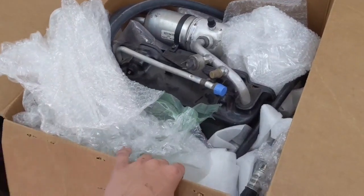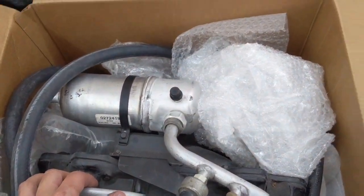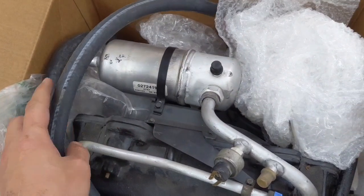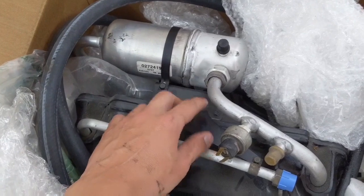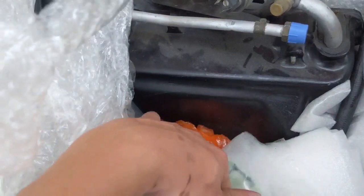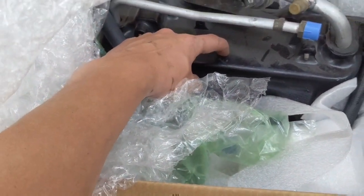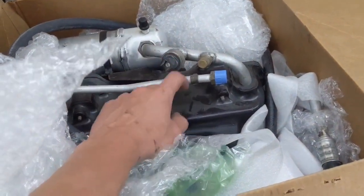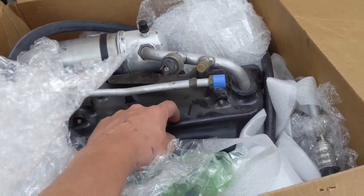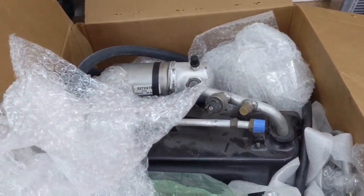Option three is a custom heater box done by Custom Image Corvettes. This is for guys who didn't want to use the vintage air system but still wanted to retain what they have. It goes in place of your original heater box. Now you're going to look at this and think it's the same box, but there is a notch shaved out of it that helps you clear the right-side valve cover. This is definitely needed unless you want to relocate your coil packs, which I don't for the look I'm going with — so we're going to change this box out.